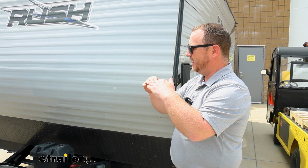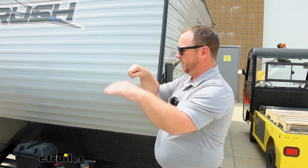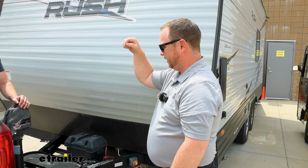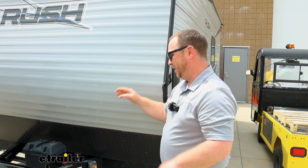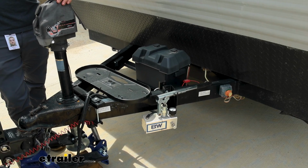Pull your truck on flat level ground, measure from the ground to the bottom of the front driver wheel well, then couple your trailer on it. It's going to change that measurement. You'll take that second measurement and you'll pump that handle until you get halfway in between those two numbers. And whatever that needle says at that point, that's exactly what you're going to use every single time.